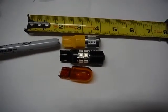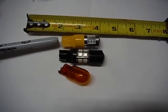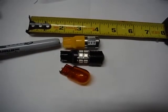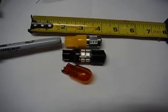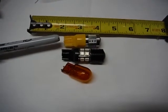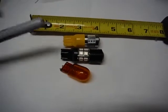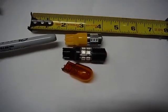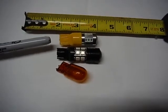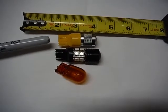The deal with the Samsung bulbs, or why I'm so happy with them, is the current is actually regulated. So it's going to pull basically the same amount of power whether it's 10 volts on the battery or 12 volts. The LEDs are going to be fully utilized — it's not like they had to design the bulb to accommodate 15 volts and then when you're running at 12, it's a lower light output.